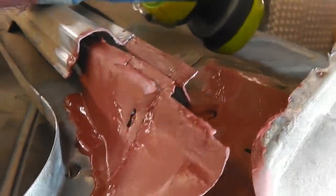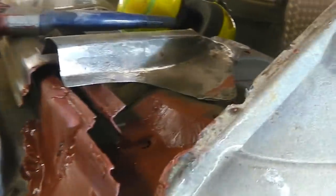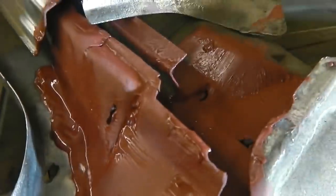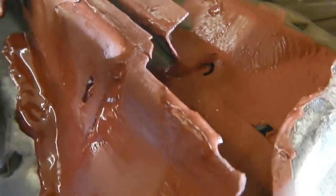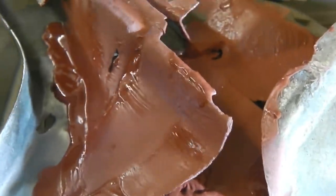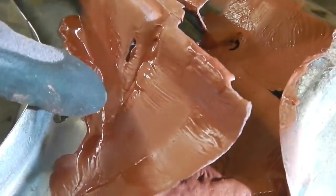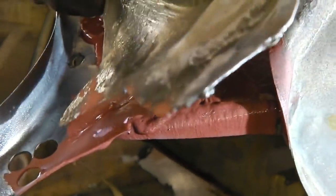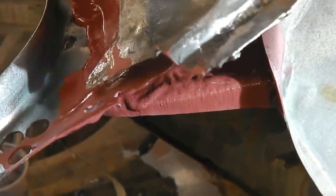And then I was right about this. There's that Ford, they did this on the scuttle and people weren't sure that it was supposed to be there. It is supposed to be there. That recess is to put mastic sealant in. It comes down and it goes round, and you definitely pump seam sealer into that before you place this panel over it. It is definitely right.